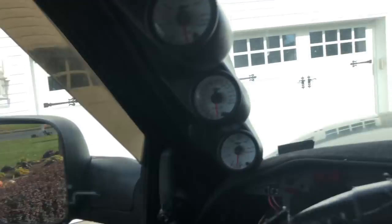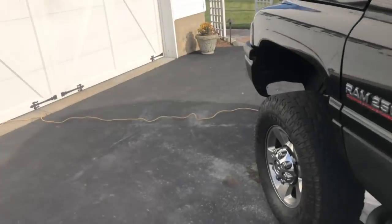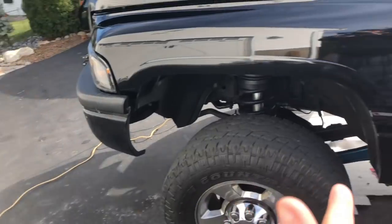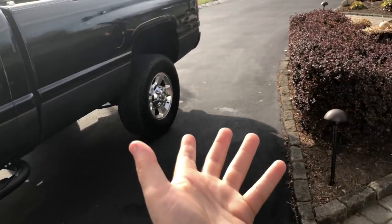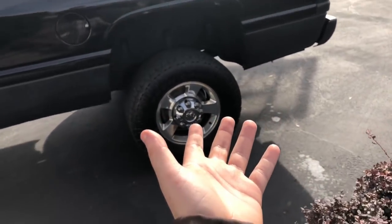And it turns out, if I plug the truck in and start it, there's like no smoke at all. So that makes me think that it's just like a grid heater issue or something. Because I also have a clip that I'm gonna show you now of how it starts when I cycle the key multiple times. So I'll show you that now. Boom. Happy about it so far.